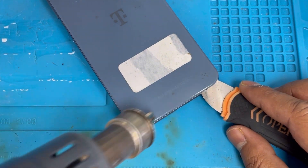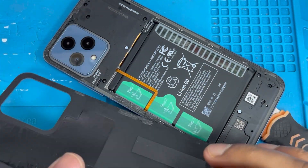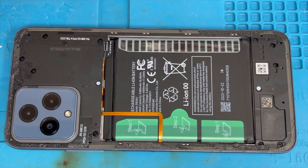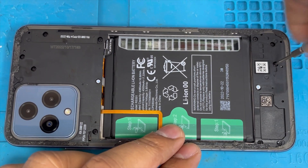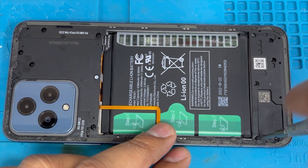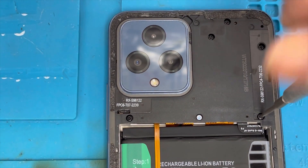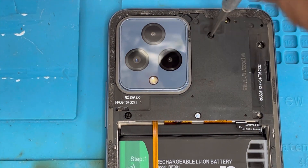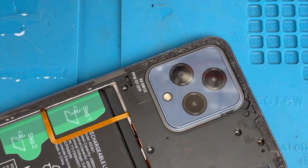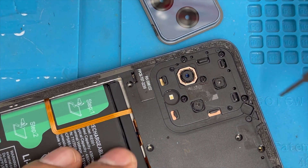This is more easier. We remove this back cover — now remove all the screws. On the bottom side here are six screws to remove. On the top side here are five screws to remove. And it's not done yet — under the camera cover there are a couple more screws. You can see here are also five screws left — you have to remove those too.